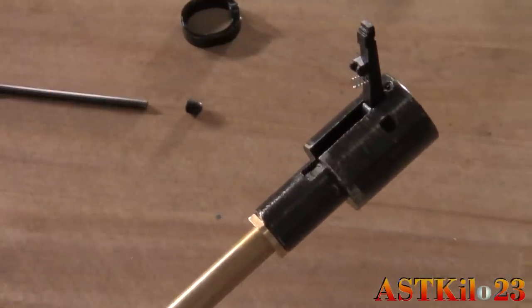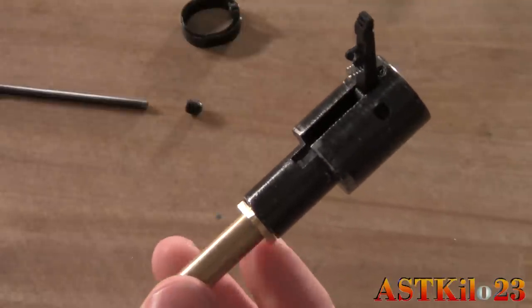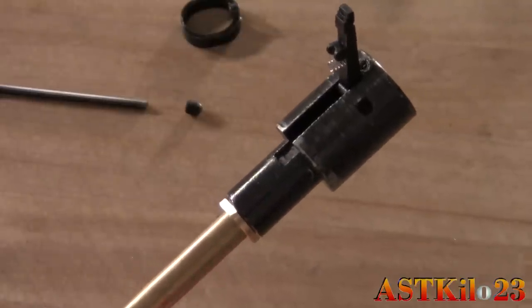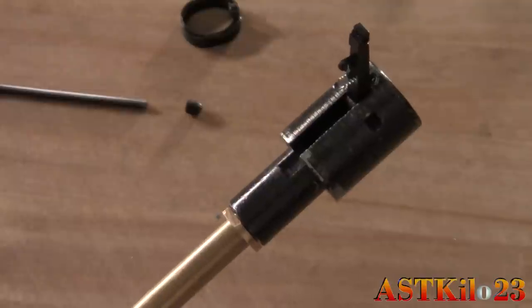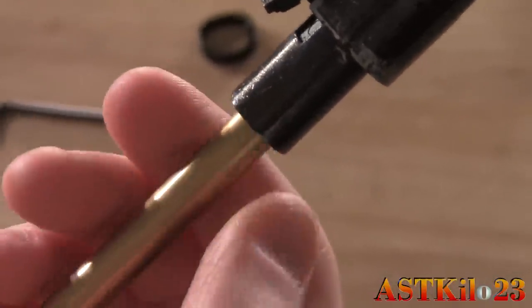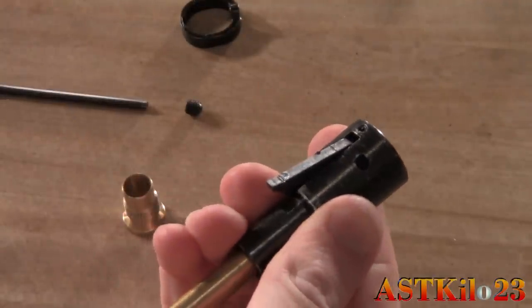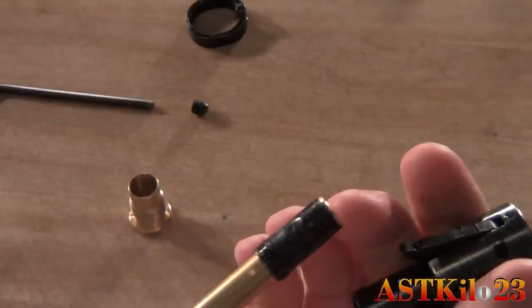The next major thing you need to do is remove this copper bracket here — it basically screws into this longer shaft. Take a pair of needle nose pliers or channel lock grips and unscrew it counterclockwise. Once you have it going it unscrews pretty easily and should just fall off. Set the copper bracket aside and pull your bucking and everything else out.